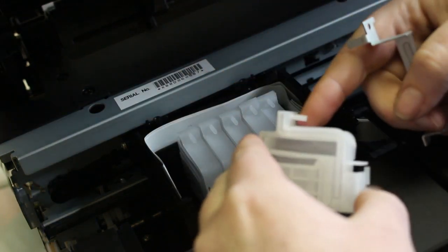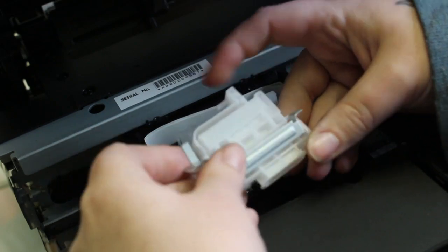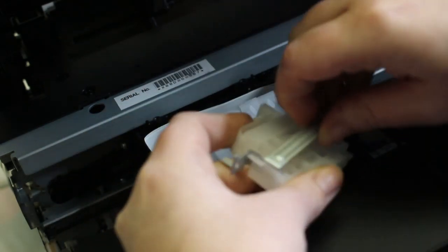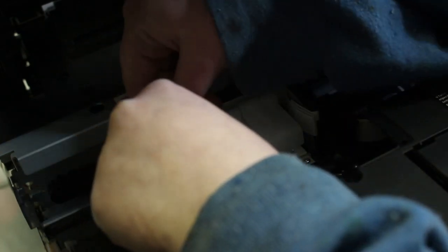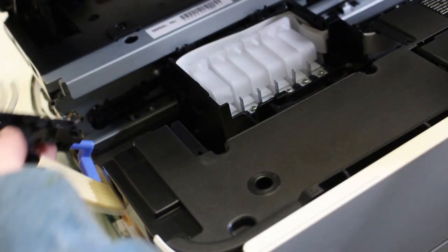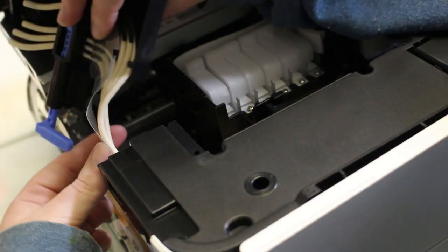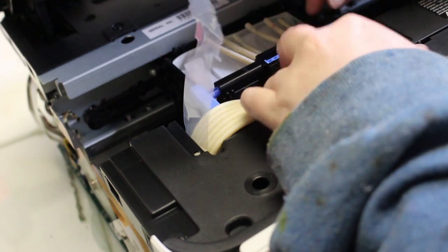I did not put in this video how to take them out, and maybe I can make another video showing how to take out the dampers if you would need help with that. But with those brackets, again, once you take the screws off, if it's hard, you can stick a little toothpick or a dentist pick in there and pull on the bracket to pull it loose, and then you can lift up that damper if you would like to. That's the easier way. But all right, now we're going to put it back. So we're following our steps backwards again.